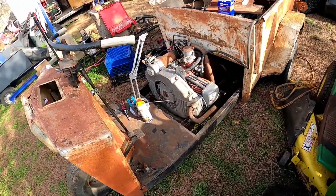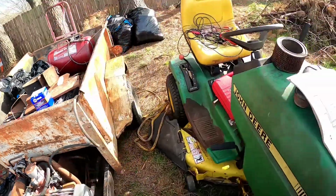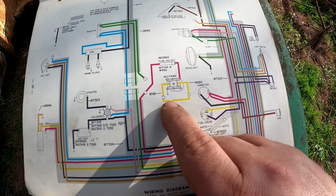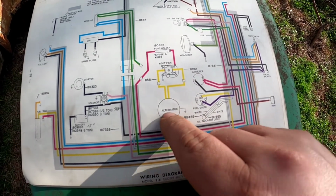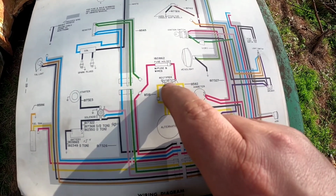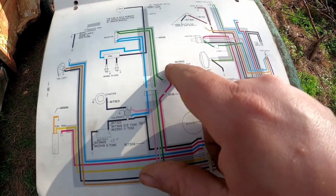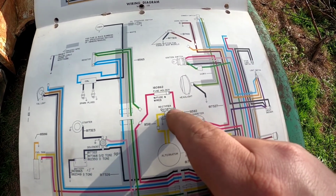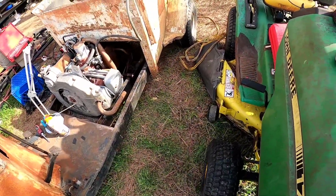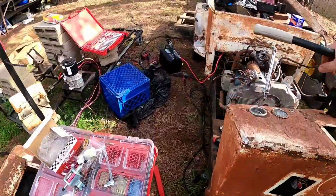I also looked at the rectifier right here, and it's got the 2 wires going in from the built-in alternator, 2 wires going into the rectifier to each of the diode connections, and then you got power coming in through a fuse holder to the positive side of the rectifier. Weigh that down so it don't blow away.